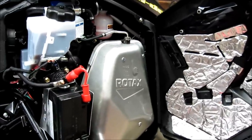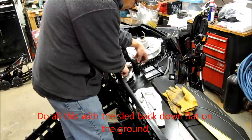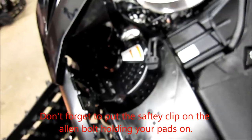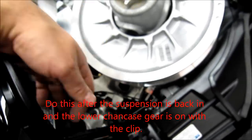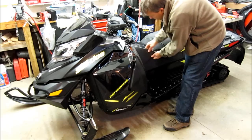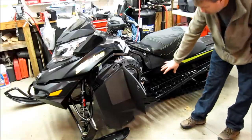Slide your brake pads back in, put the brake pad retainer in, torque that bolt, and put the safety clip back on. The brake cover goes back on with the stud underneath, then the three bolts, and then the belt guard goes back on — that protects a broken belt from taking out your brake caliper in the emergency a broken belt already creates. All four of those bolts are done.